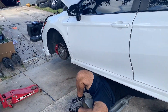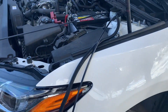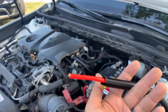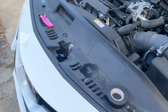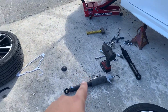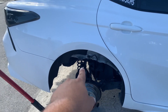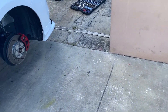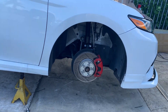Cisco is going around, putting the air lines through — he's running the air line through the bottom. I ran the wiring this way and covered it up, going to the battery and connecting to the fuse. His brother took out the rear suspension and is working on putting the new ones on; the spring will come off also. It's coming along pretty good — almost there, these are already set, just waiting for the air lines.